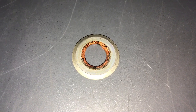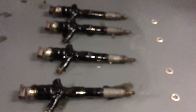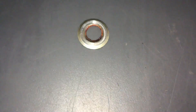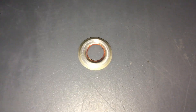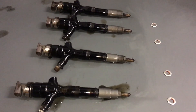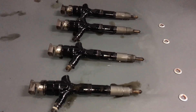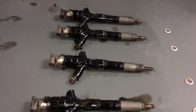You can see this one is eroding at the bottom, at about five o'clock position. This one you can see it's the right side, three o'clock, really eroding away — so even though it's only done half the k's of some others, it's moving. Up at around eleven o'clock you can see the taper, you've got the flat area and a taper on the inside and outside of the seat — on the inside they do erode and wear away. Number three was the tight one that instigated this whole process. The erosion just continues and continues and eventually they leak. It is part of the normal maintenance schedule.